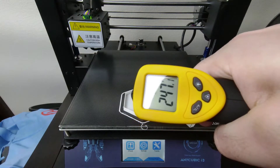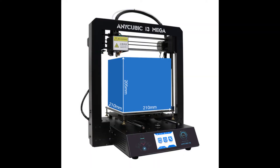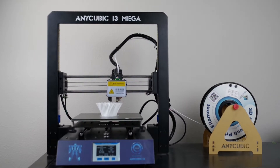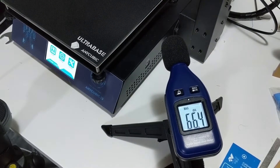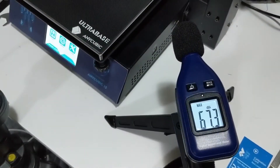You would need to mod your CR-10 to hit close to those temperatures. So what are the downsides? The print dimensions are only 210x210x205 — respectable, but by no means large. The print speed isn't very fast, usually around 60mm per second. The Prusa Mark III can approach four times that speed. And the fans on this printer are loud — many people replace them, but the stock ones are louder than most.